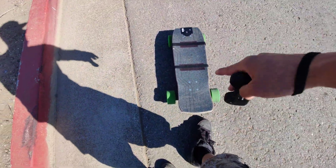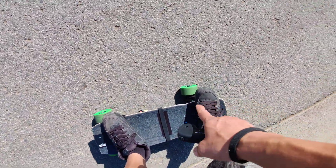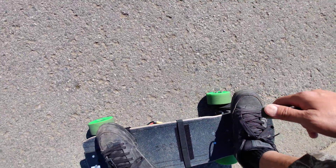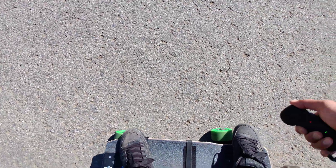Because the back trucks are longer/wider, the single belt stays on the ground more — there's more pressure down. I just randomly made it this way but I realized: if you put wider trucks on the back for a single belt drive, it's gonna allow you to really grip the road a lot better, even with just one motor, especially when turning. My turn rate is really good — let me go ride it real quick. I can make like a four-foot diameter turn.